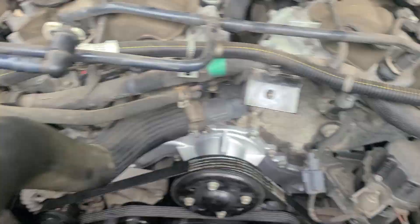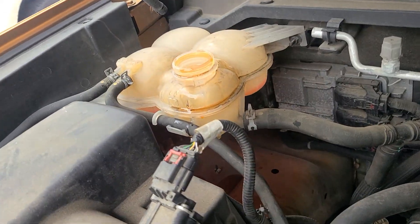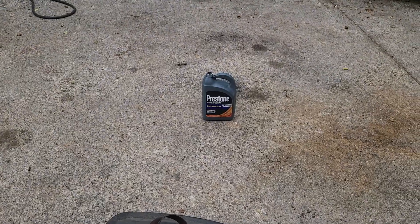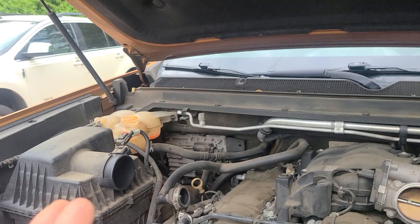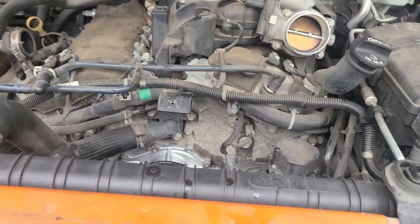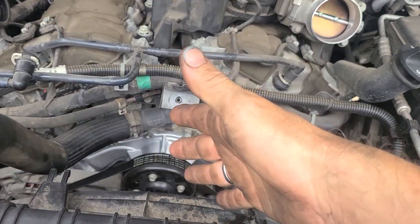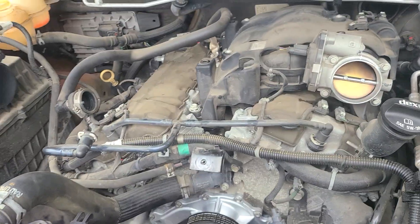You should be able to do this job, and if you're reasonably competent there's no reason why you can't get it done. I've already put in almost a whole gallon. I bought Dex-Cool concentrate — ideally get the GM stuff, but any Dex-Cool orange will work. Buy the concentrate because you're going to need at least two gallons, and try not to reuse your old stuff unless you absolutely have to. Peace out, and hopefully you learned something.